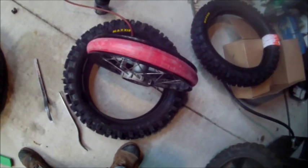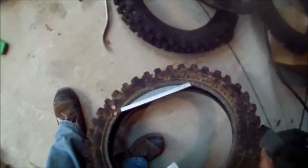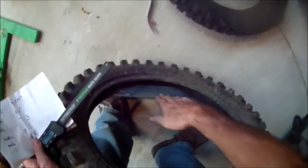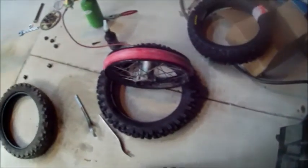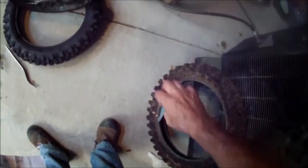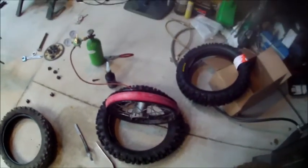To put this thing on, it's just the reverse of what I just did. You're going to put the whole wheel inside the tire. It comes with this little plate — it just grabs the bead on this side. As you take the whole rim and put it in here, it's basically just a guide to keep the rim from popping out the back side. The issue with the wider rim is that piece of metal barely even fits on there as it is. So I had to take another one, spread it way open, and make some little tabs for it to sit on so I could actually get it over the bead of this tire.